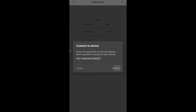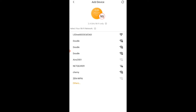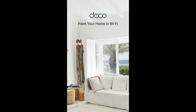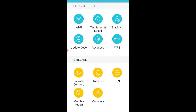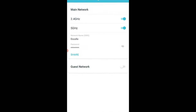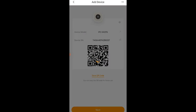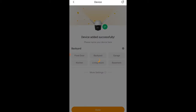When I went to connect, it spells it out at the top — it says no 5G or 5GHz. What I had to do was, even though I thought I was on the 2.4, it would not connect. So I went into my router — and routers can be different — but on this one I had the option of turning off the 5GHz. I just flipped that off, went back into the IMU app, did a scan, and everything added fine. It only took just a couple of seconds, and once you get to the addition screen it tells you it was successfully added.